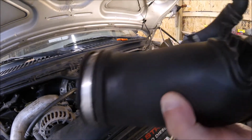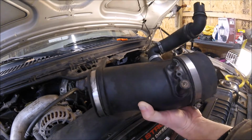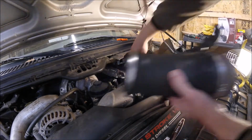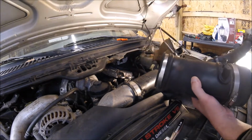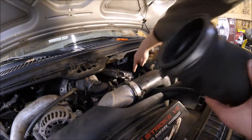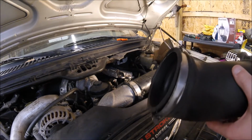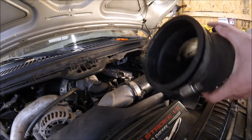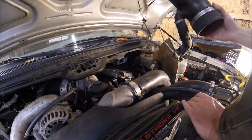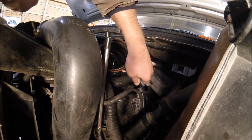It right here, it's just plastic. There's two, and it has a nut inside of it. But if you over torque it, it snaps the plastic. So don't over torque it. And this bracket mounts right here on this bracket for the fuel injector control module. And this hose goes right down here on that cover on top of the valve cover we put on. It's an overflow vent, I should say. Some guys, I think, take this hose and they just route it down to the ground so they're not putting this oil back into their turbo. This is the vent tube.